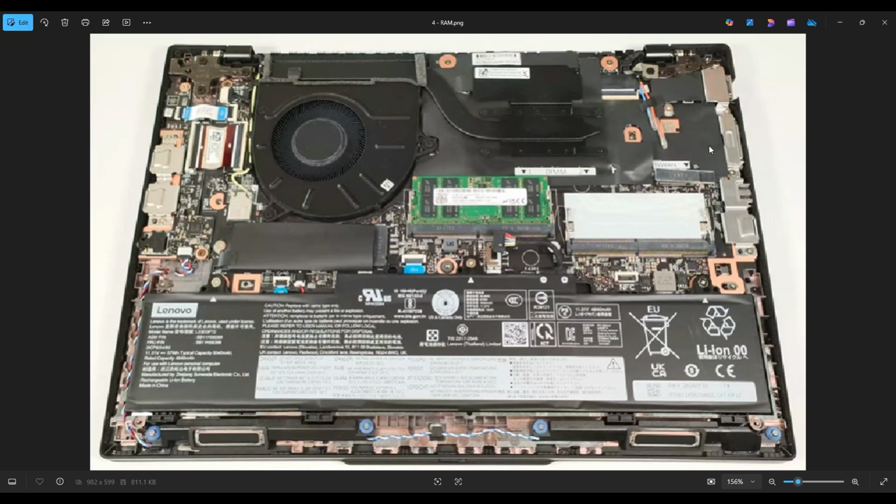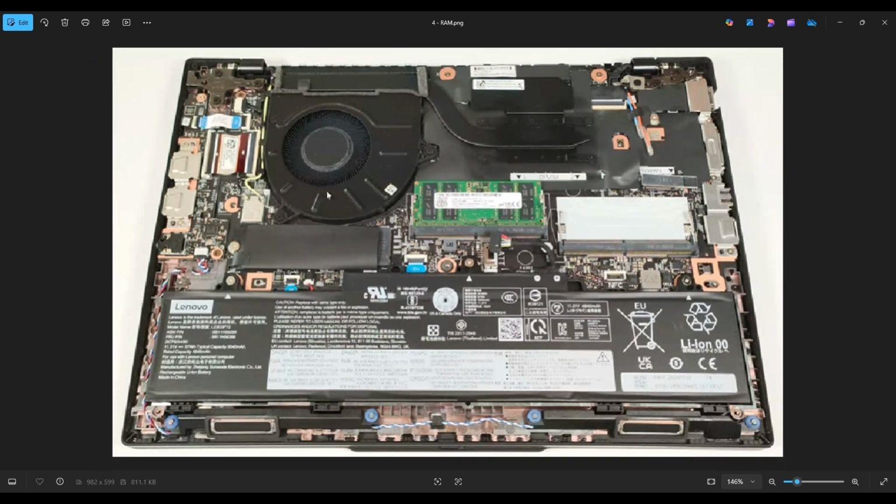And I guess the last thing to mention, if you guys are looking to upgrade or max out your RAM, you're probably aware that RAM is a large component to the speed or the performance of your computer. If you're looking to upgrade more things to get more speed, consider upgrading your storage device. Your single storage port is right here. This is an M.2 NVMe port. It takes 2280 Gen 4 solid state drives.